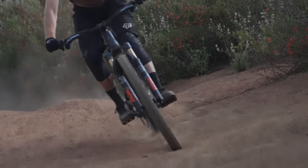It did surprisingly well for what we were riding. I gave the Magic Mary a 7.7, and that is my favorite front tire I've ridden over the years. I also knew from growing up riding where we tested the tires that loose over hard pack conditions is definitely not its strong suit. It offered a lot of grip and traction, especially in banked corners or long flat corners where you're really settling into a lean angle. Awesome grip and traction, a lot of control. I started to not like how the tire felt in higher energy berm corners where you're putting a lot of force to the front tire. I think those side knobs are just too soft and there's too much siping on them — it started to make the tire feel like it was rolling. It was really the only tire where I had that sensation of starting to push the front wheel.